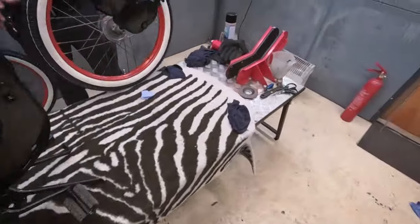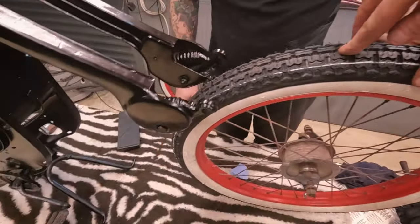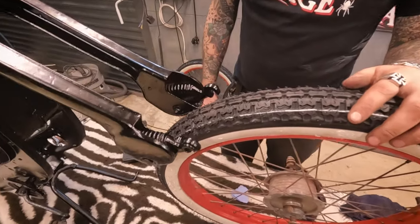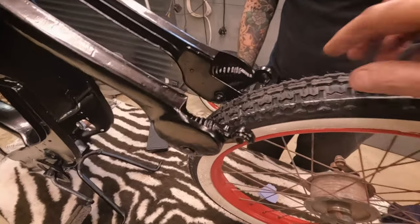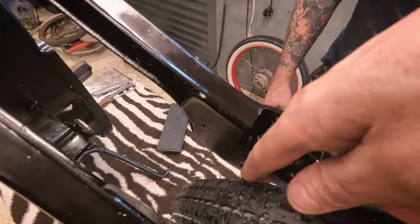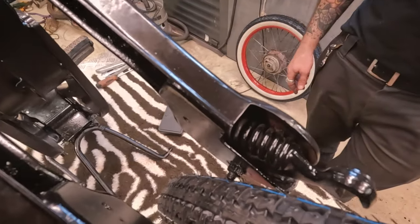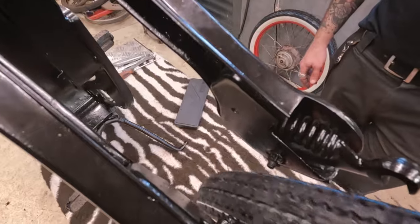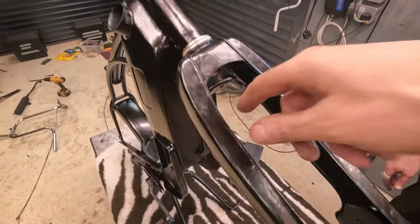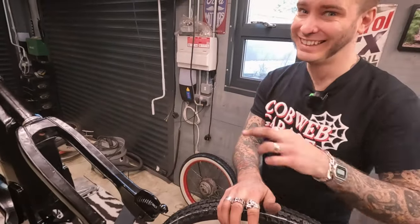And these wonderful tyres we have, which are 2.5 by 19s. The old ones were 2 by 19. So these are actually much chunkier. And they don't even go at the moment past these fork link bolts. So we're gonna whiz those off, hopefully get a bit more clearance, and just hoping that the tyre doesn't hit the top of the box.